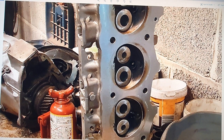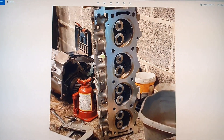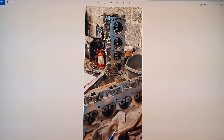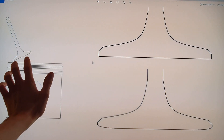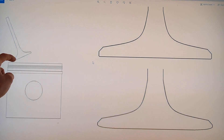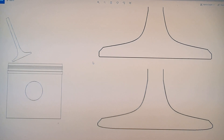So I was able to add — I don't know — 0.2, 0.5 of a millimetre or something of clearance there. I did it on all 16 valves. The next thing to do was to remove a little bit of material from the piston. The inlet valve gets closest to the piston because it is a larger diameter — if the inlet valve is bigger, you can see that it will be closer to the piston. So that was the more critical one. I just put a pocket in the piston for the inlet valve.